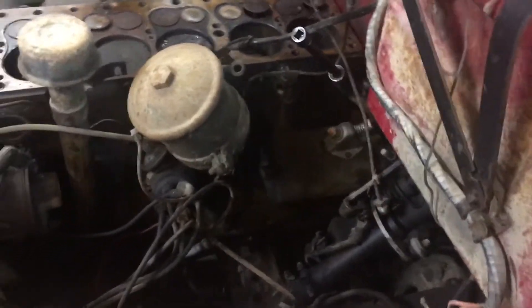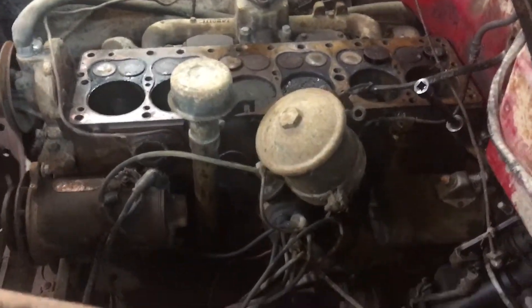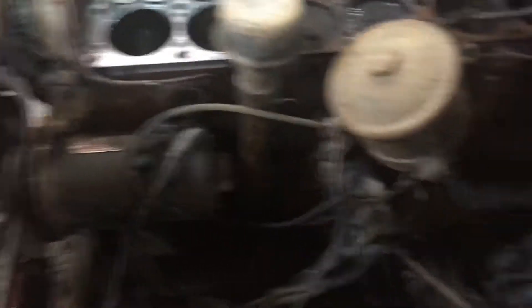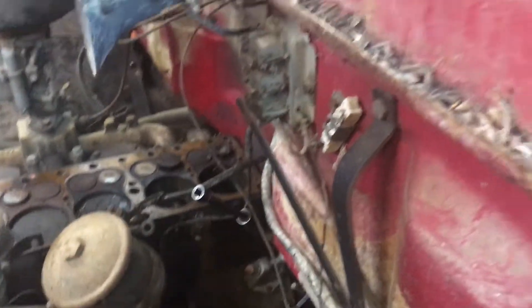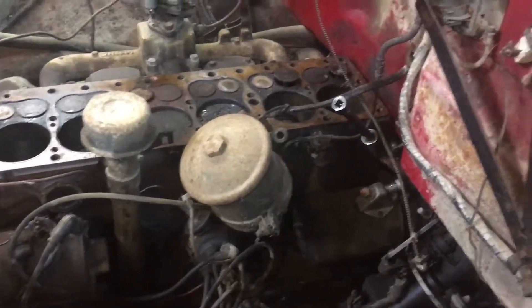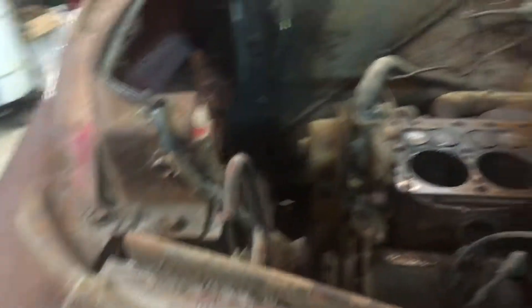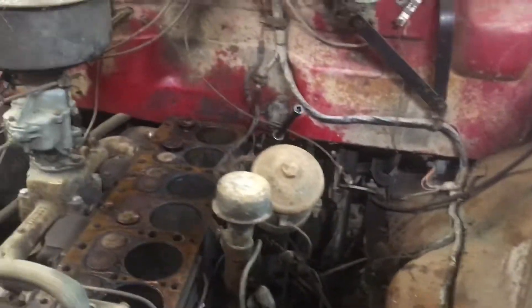They work — you just can't abuse them. If you want to convert to 12 volts, you put in a Delco alternator as an example, you can put it to negative ground like normal vehicles and have all your modern conveniences in the cab. The winding is what determines the rotation of the starter motor — it is not the polarity. I've done this on many occasions on various engines and it's been successful every time.